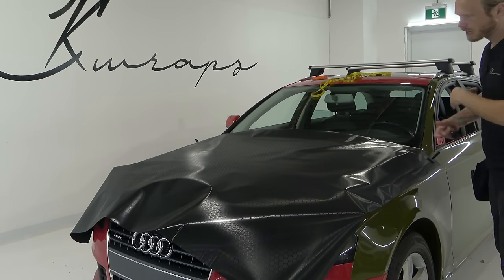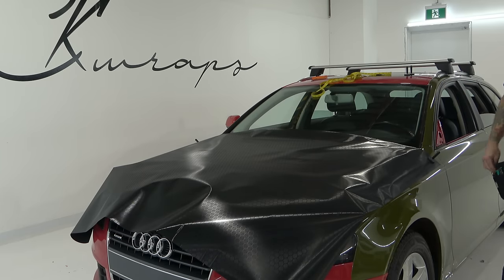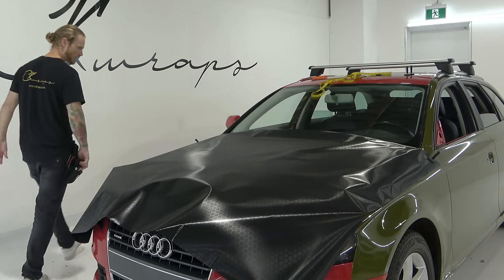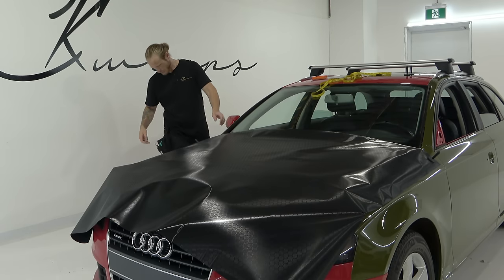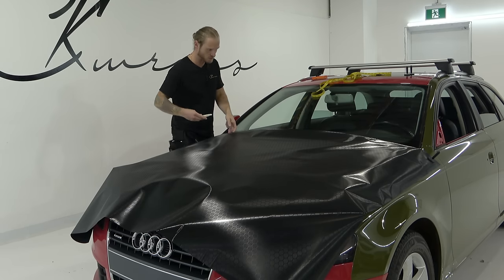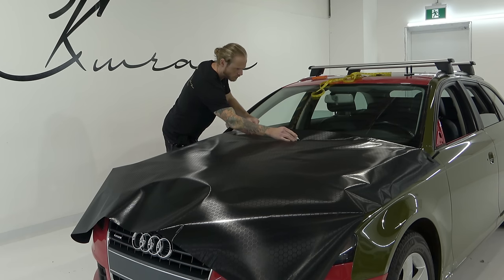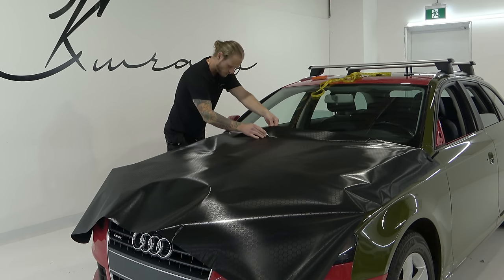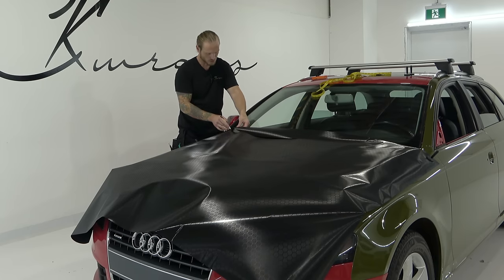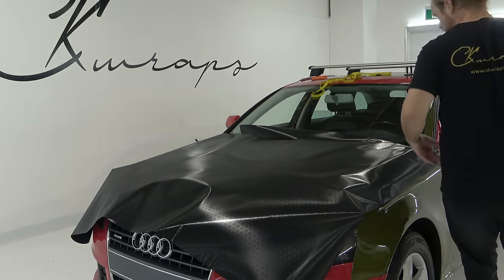I'll just put the magnets on the window and we're going to cut some of the vinyl out right in the window area — I don't want the film sticking to the actual window. I want to be able to lift the film very freely and very easily. Let's take our knife — you can use a vinyl cutter as well, but I find with a PET liner it's a little bit easier to use your knife. Sometimes the vinyl cutters don't do a nice job when it comes to cutting away extra film because of the PET liner.